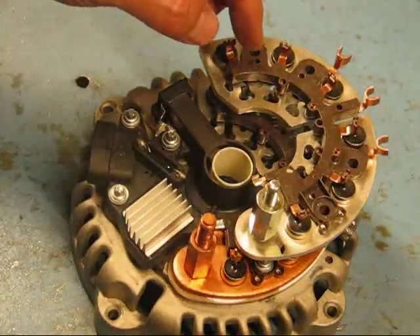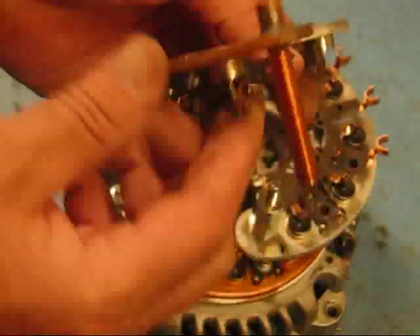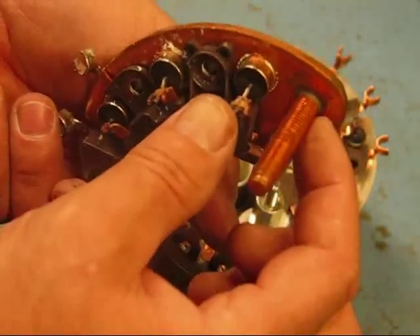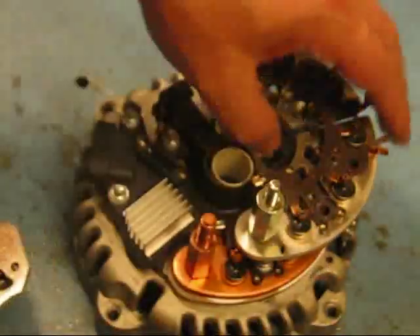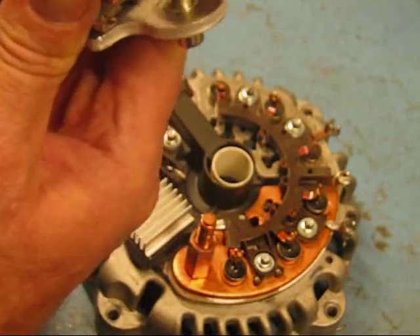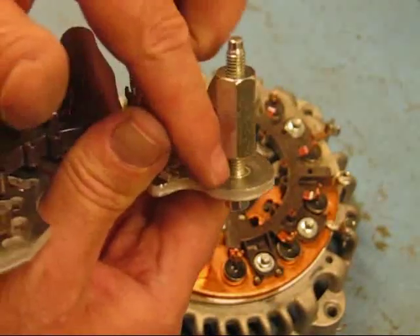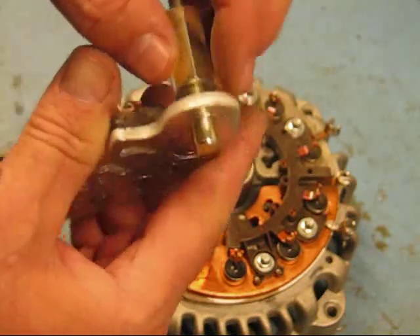The other advantage is it has higher amperage and voltage rated diodes. On the copper heat sink unit, the larger battery stud is silver soldered right into the positive rectifier. On a standard alternator this is just a swedge fit — there's just a spline or splice where the terminal stud is pressed in.